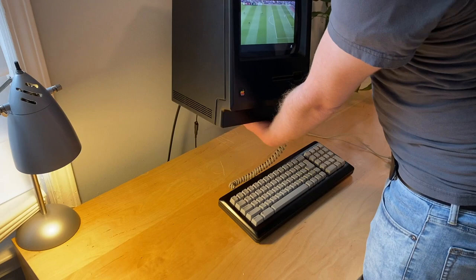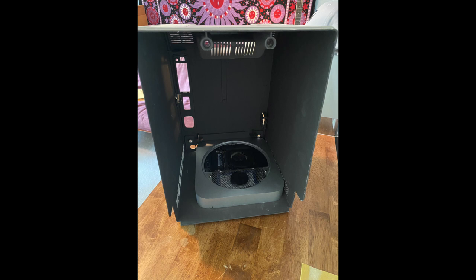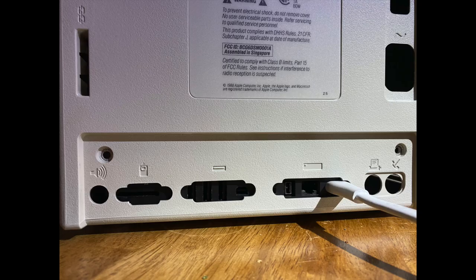After playing around with the case and a Mac Mini that I had, I discovered that a 2014 Mac Mini would actually literally fit in the rear housing. And if the Mac Mini was just placed upside down, the ports actually lined up with the original Mac Plus port cutouts on the housing. It wasn't perfect, but there were enough ports there for functionality. You got a couple USBs, power was reachable, Ethernet.